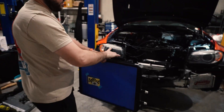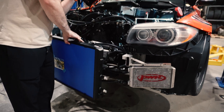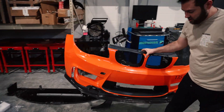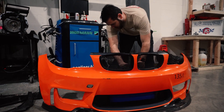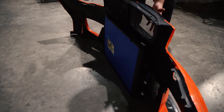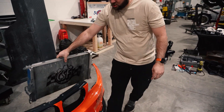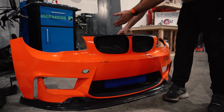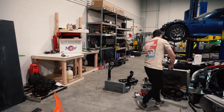The plan is to stick the CSF heat exchanger right in the front bumper opening. The engine radiator will sit behind it. Normally the bottom hole is open for the stock unit — I'm just going to replace that with the CSF, which actually has a larger footprint, which is always good. It won't take away from the nostrils that control airflow for the actual engine radiator. I pushed everything forward to get more space between the back of the radiator and the engine, which opens up pressure back there and helps airflow across the radiator face — better cooling. So I won't lose any engine cooling efficiency and I'll gain a bunch of efficiency for the new intercooler system.